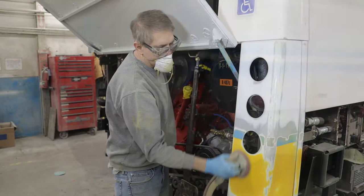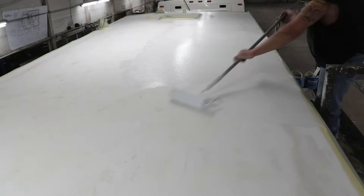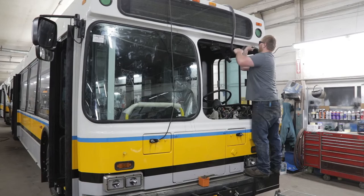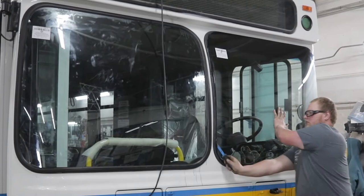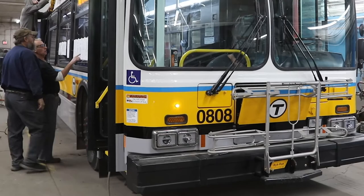The entire exterior of the bus is sanded down and smooth, including the panels that were removed. The bus and panels are then carefully painted to the color scheme of the client — in this case, the T. The top of the bus is painted with a thicker weather-resistant coating. New windows are installed with the latest windshield technology. Exterior trim is put on, and the refurbished, repainted doors are reattached. Everything is polished, and the front is fitted with a new bicycle rack.